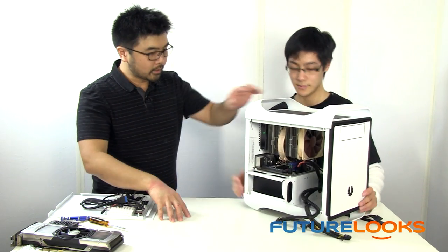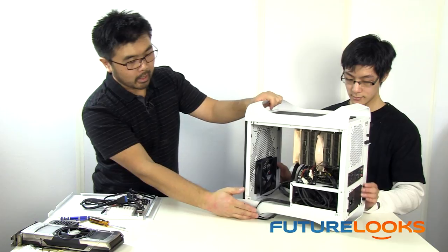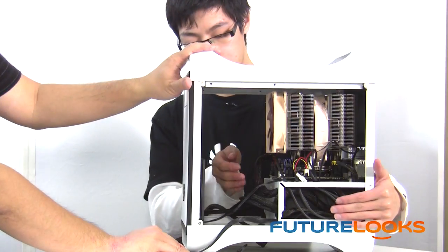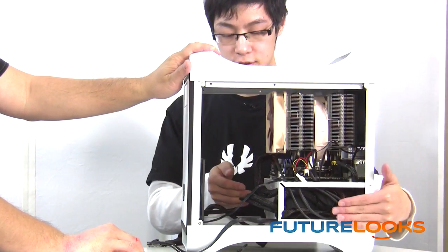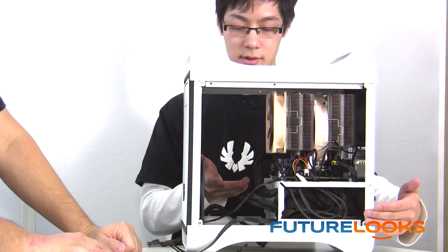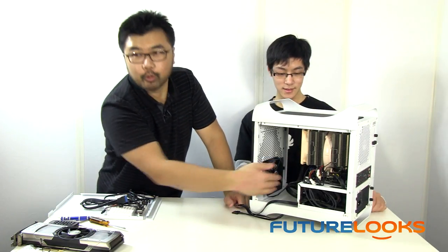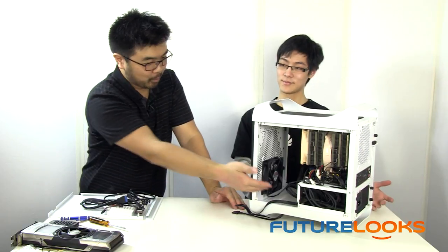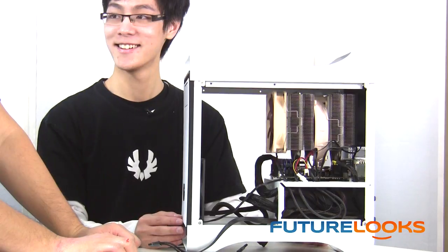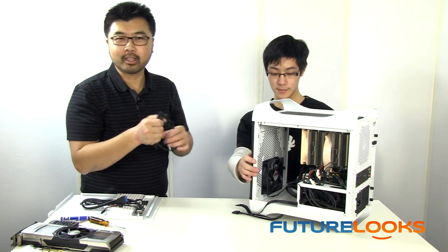Jackie has just finished doing a bit of cable management. Jackie, is there a reason why you picked this area? It's directly beside the power supply, and because you have a solid side panel here, you're not going to be able to see any of the cables anyway. You don't need to zip tie them — just stuff them into this compartment. It also keeps the main area clean in case you want to mount nothing there, and there's no airflow restriction. The next step is getting the SATA cables into the case and to the back and getting power to them.